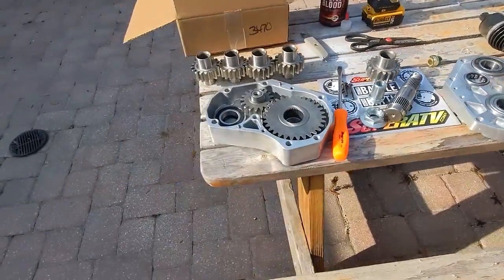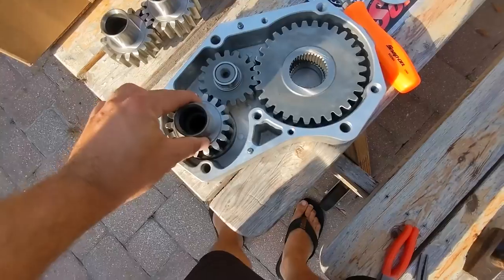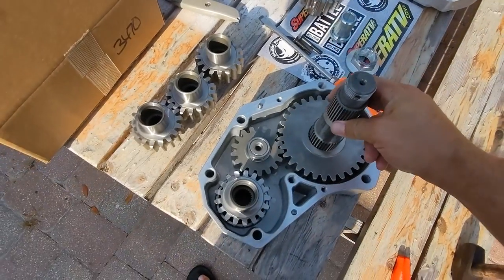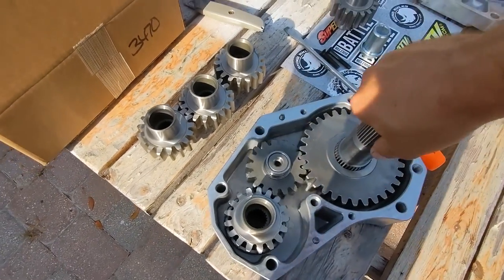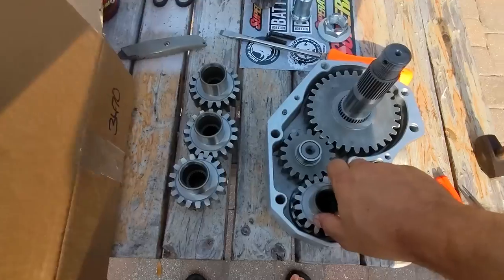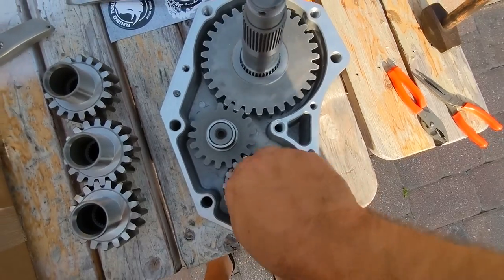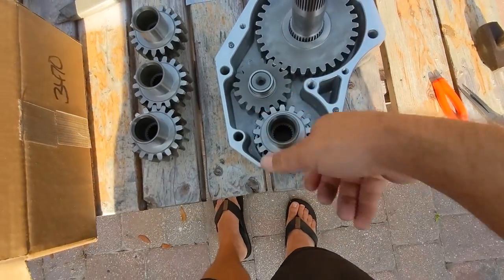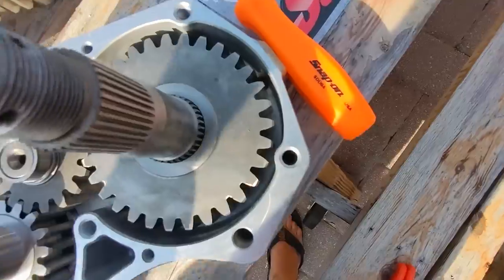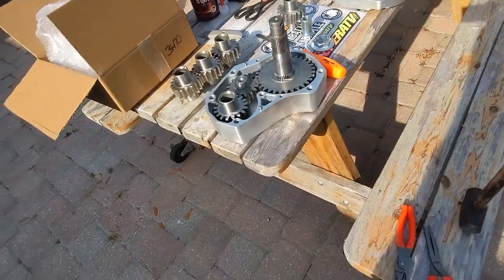Let me throw one of the Pioneer 500 gears in here. The gear goes with the spline side down and drops in there a lot easier than the P1000 gear. Put the shaft in to center the driven gear — your axle spins this, and there's your reduction. Pretty good teeth mate, not a whole lot of slop. This gear's offset because it's a 6-inch portal. There's a good bit of space around here to hold oil, and there's a nice drain plug at the very bottom. The gaskets look pretty improved and solid.